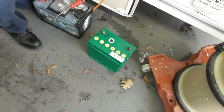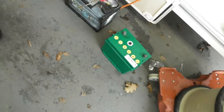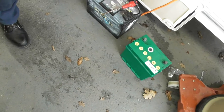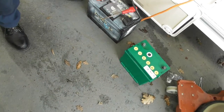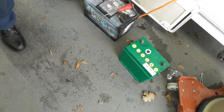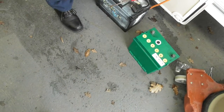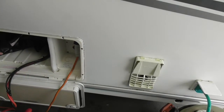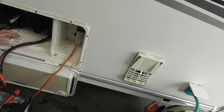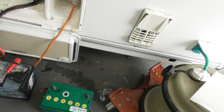In theory you shouldn't need that unless you're on an aerial, but there are some sites, especially in mid Wales, where TV reception is really poor. The site will have a huge mast and a TV point on your post, so you'll need the cable to run from the post to your van. What this saves is rather than putting the cable up through your window, it's already wired in and comes out the side of the van. For satellite, all it is is the little screw-on attachment - the other end is exactly the same as a TV aerial and you can just plug your lead in.